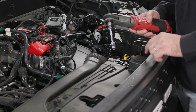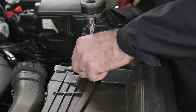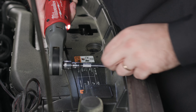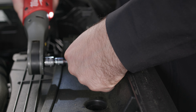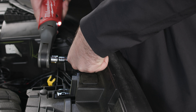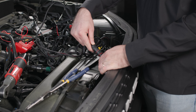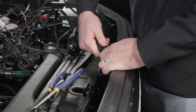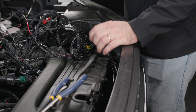To get to the connection from the bar we're going to need to remove this plastic valence. To do so, there are four 10 millimeter size bolts on the top and six 7 millimeter size bolts here that we're going to go ahead and remove. We ran our connector behind the grille and up into the engine bay, so we're going to take our connection from the harness, line up the tab and the slot, connect them, and then lock this collar into place to really weatherproof this seal.